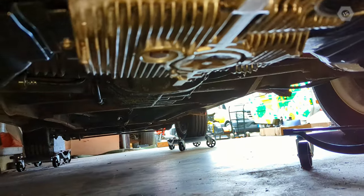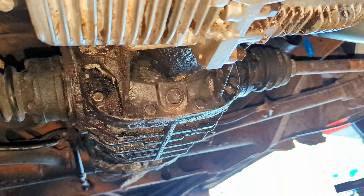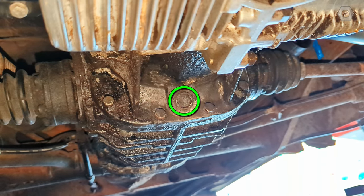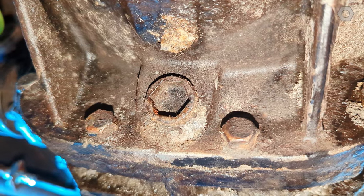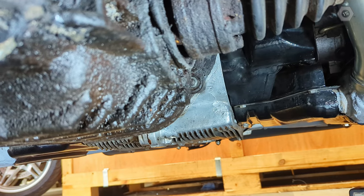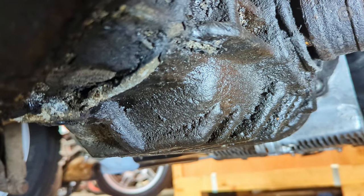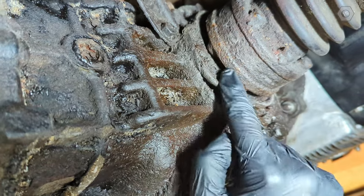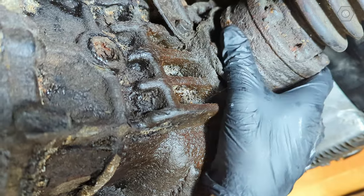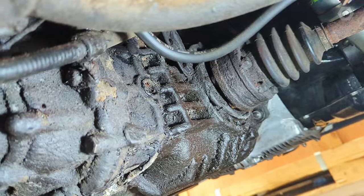Here's our lovely clean engine. If we look forward of it, that thing that looks like the Talca riverbed — that's the gearbox. We can see the oil drain plug which faces rearwards. We're not concerned with draining the oil today, as this is just a check and a top-up. The filler plug we need to find is on the left-hand side of the gearbox. This item here is the left-hand driveshaft assembly; there's a seal in here which has failed — that's the reason for the mess. That thing that looks like a chewed toffee is the filler plug we're looking for.